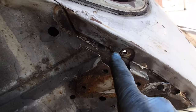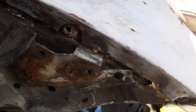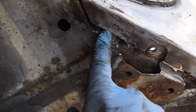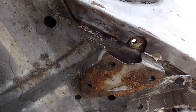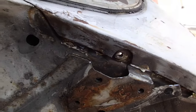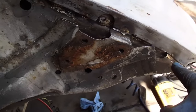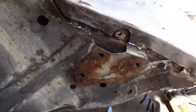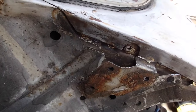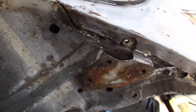Well, yet another discovery. Cleaned everything up, and if you can see here, see how that looks a little bronzy? That, and that were the attachment points. I cut those free, and now that's not attached anymore. So, apparently, the old spot welds are gone, and just those little brazing welds are in place. So that was a little easier than expected.